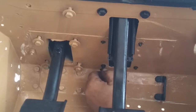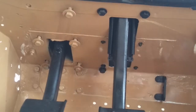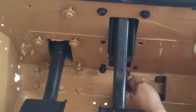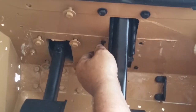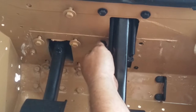You'll see now that I've got a nice seam-sealed, rust-free, freshly painted firewall, which is probably the most important part of a Land Rover because it's a very integral part of the vehicle's strength. If they're used a lot off-road they do flex and stress crack. I've had to do a couple of small welding jobs on there that weren't rust related — they were actual stress cracks.